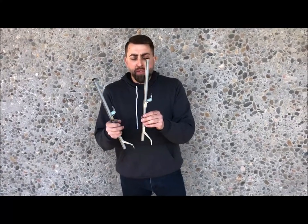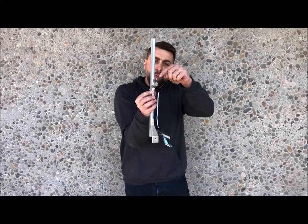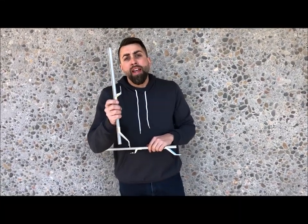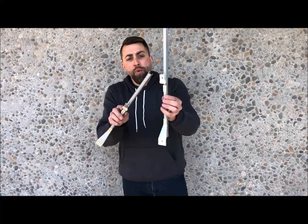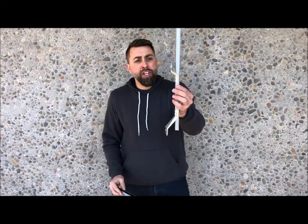From 66 through 68 the upper door frame was removable. When that took place, your door track would have had a slot cut in it, and this portion would have wedged between the door and the upper frame. Then in 69 they welded the upper frame on, so the door track had a welded-on nut that the bolt mounted through the outer shell.